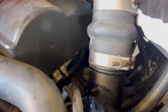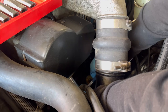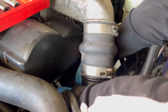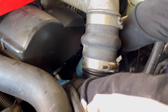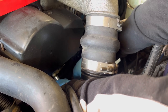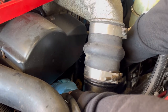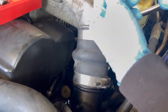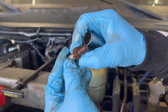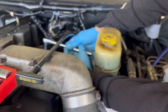Pop the vacuum hose off really quick and get that out of the way so we don't break it. A 17mm takes off the stock bolt off the VP44 pump. Be careful when you install your new fitting because the old crush washer could stay stuck with the VP, and if this is your first time doing this, you will learn that will cause a leak sooner than later — you will drip some fuel down. Don't want to lose those crush washers; you won't need them, but if you want to turn your truck back to stock, you will.